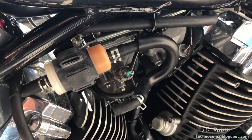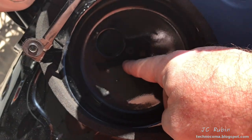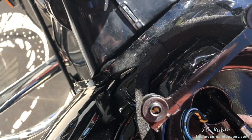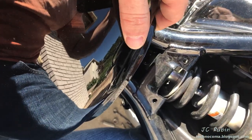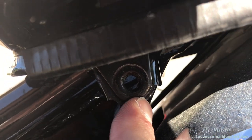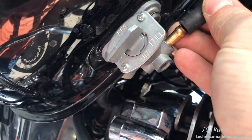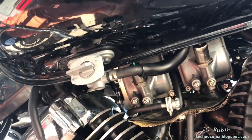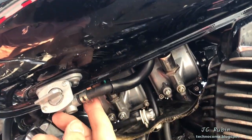Having completed the test, I'll put the original hose back on and start putting the tank back on. I position the tank in rough approximation, then lift up to get the speedometer and power cables back through the hole. I've got enough through to work with. I get those round rubber discs back in their tracks, then walk the tank forward from the back to get it into position. You'll know it's in position when the rear screw holes line up with the threads on the chassis. We plug in the hose from the tank into the petcock and the retainer clip goes around.